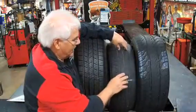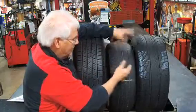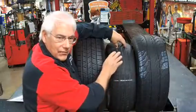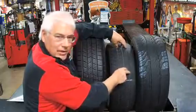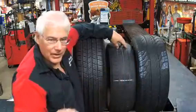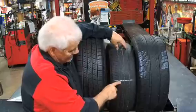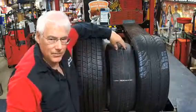It's actually unsafe even though it looks like it has some tread. You might think you don't need tires right now and you can get by. But if you have wet, icy, or snowy conditions, there's really not enough tread for the tire to grab the road. If you have to slam on your brakes, it's going to be like a slick tire because that tread wear indicator is worn. This tire needs to be replaced.